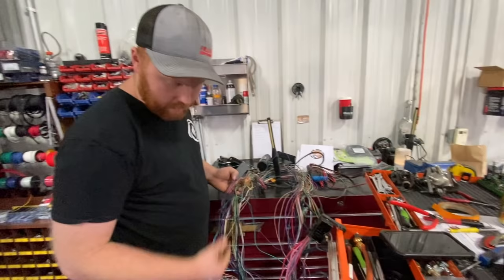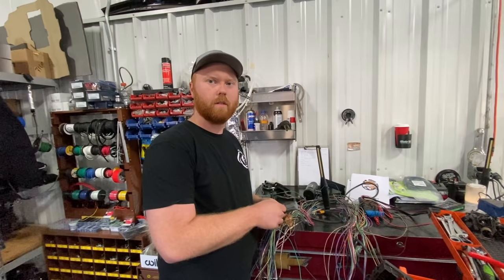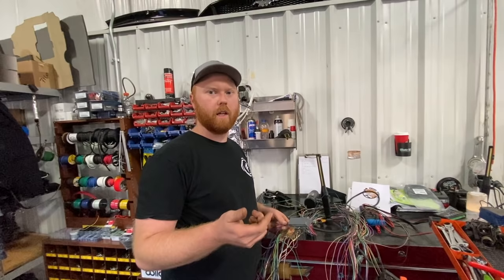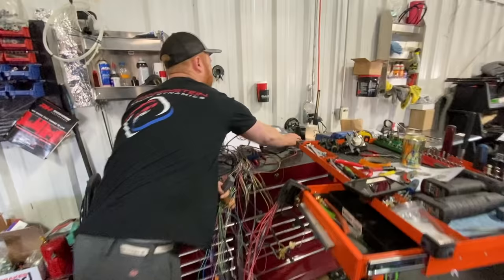And like the charging system. The thing I ordered earlier for you was a deal that Dakota makes that basically plugs into the OBD2 port. That way we don't have to have all these wires running into the coolant sensor. Oil pressure? Yeah, oil pressure, coolant temp. So basically it takes all the info from the PCM and just puts it into the dash. Nice. Instead of individual sensors. That's pretty cool, and it was only like $100. Yeah, so it plugs right into the OBD2 port. Pretty cool module. And then that's all the wiring basically on this side of the block.